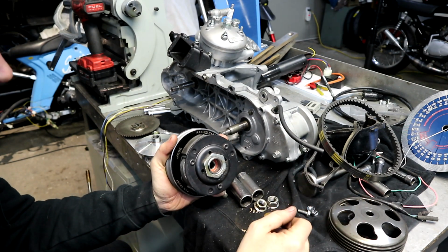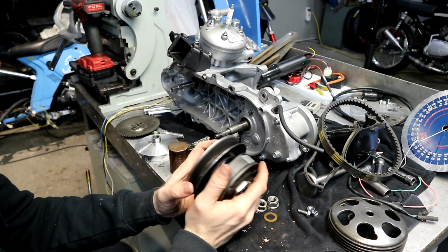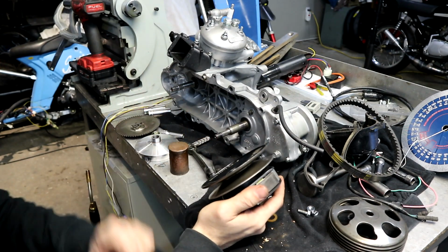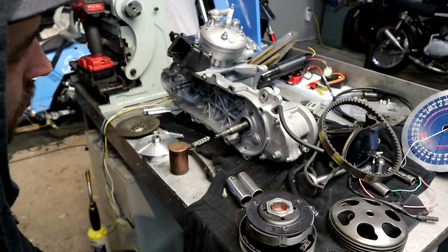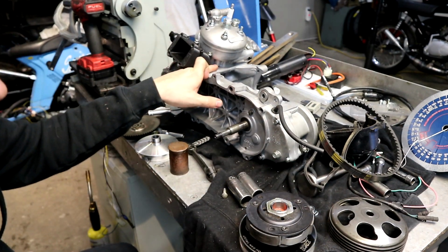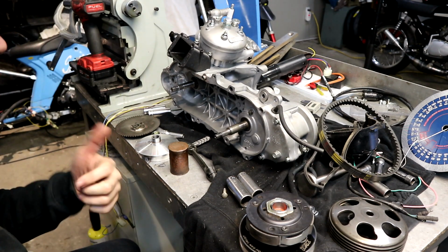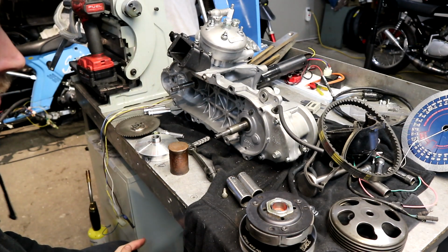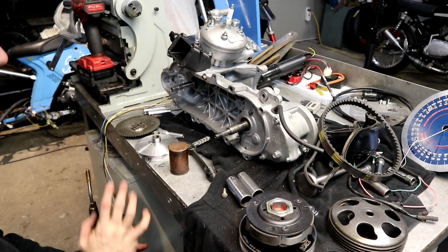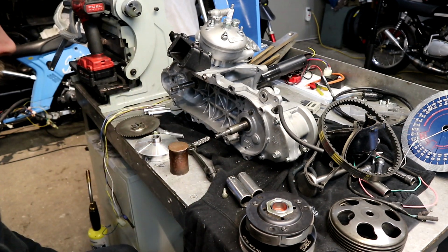And then you can run the big Peugeot 112mm Stage 6 RT clutches on a Honda and still have full pulley travel. And also in that video, I'm going to be providing the base plate DXF/solid file for the Stage6 RT95 build. And I'll discuss all of the nuances for all of those in the video. They're provided as is with no warranty implied, yada yada, etc, etc.